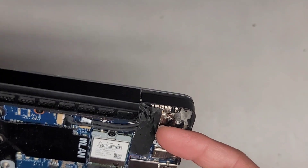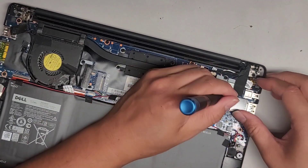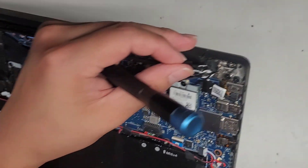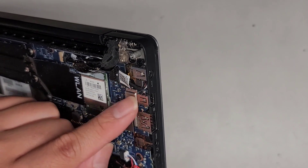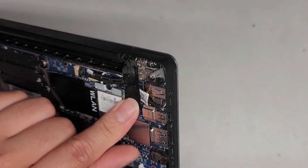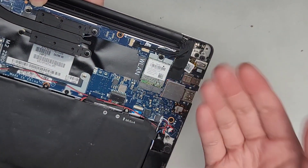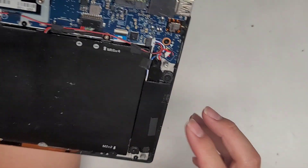You got the DC jack charge port connector underneath this tape here. Normally I don't peel all this stuff up, but this one's completely dead — the customer got a new computer and they're basically getting rid of this. The charge port is connected here with one screw, but the cable wraps underneath the motherboard. When you go to replace the charge port, you'll have to take a bunch of the motherboard screws out. Usually I just remove screws from over here, lift it just enough to slide the cable out without pulling the whole motherboard out, and coil the new one the same way.